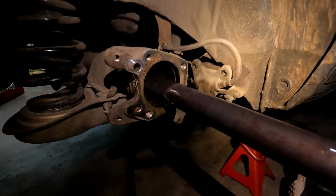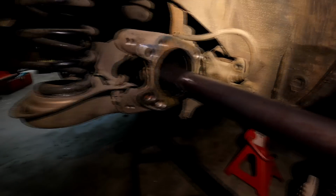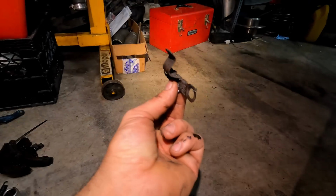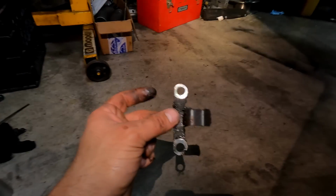But yeah, so we're gonna wanna take those dust shields off. And then once we're done that, we're just gonna reinstall our axle just how it was before. But the only difference is you don't need these clips anymore. So these were to hold the factory e-brake shoes in. We're deleting everything to do with the factory e-brake system, so those can go.